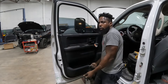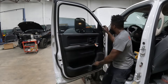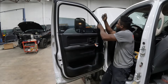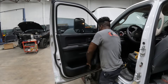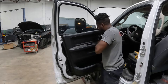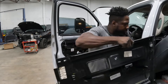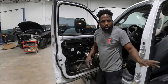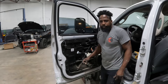Now you're gonna hold the trim panel and you're gonna pull it up, okay, just like that. Take that piece off — flat head right in the groove, pop it out just like that. Hold it, pull it up, hold the handle out, take that piece out. Comes right out. See that, comes right out guys. That's how you take off the trim panel guys. Now we're gonna take the glass out, okay, stay tuned.